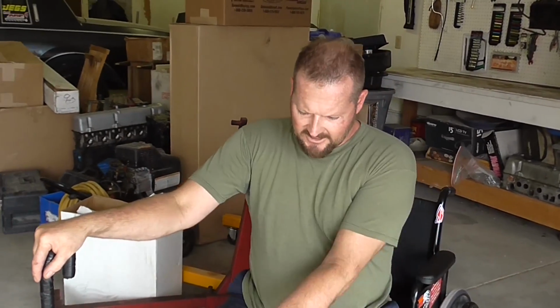There are so many things you can do to these cars to really bring them out, like catch cans for the oil mist that comes out of the valve covers. If you control that, then you have less chance of extreme carbon buildup from the burned oil on your intake valves and your exhaust valves. So food for thought. The money you save doing a budget exhaust will be money you can put into other mods or keep in the bank or in your pocket.